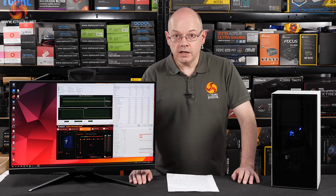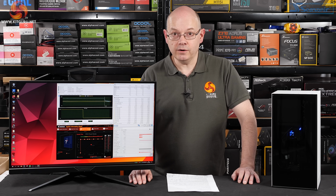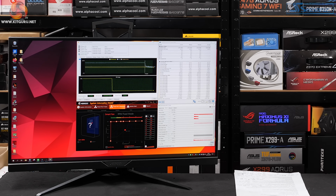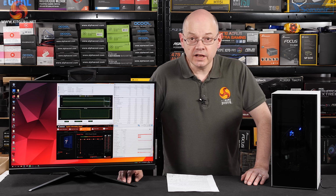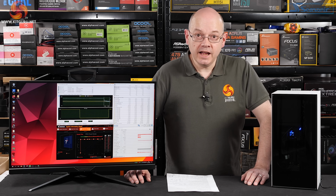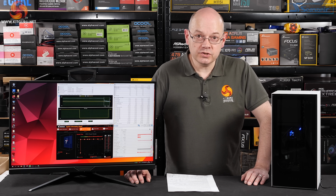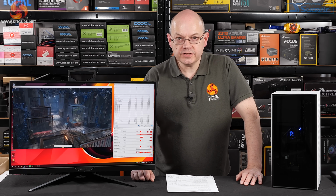You see? If I now kick off a stress test, I'm going to use AIDA64, you'll hear the fan ramp up within moments, and it's really quite noisy. But then why shouldn't it be? The system's under unreasonable stress and the fan's been told to run at full whack, which in this instance is 1800 RPM. Running the TimeSpy stress test is interesting.